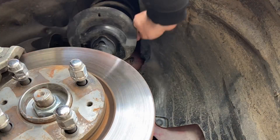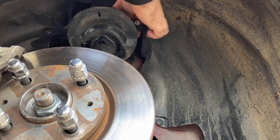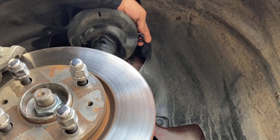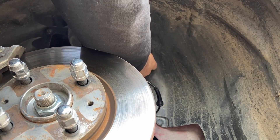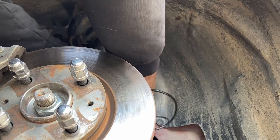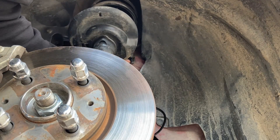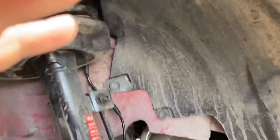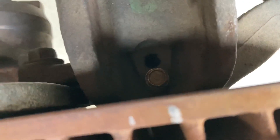Let's install it. All I'm going to do is pull out this connector, pull this off, and install the new one — it goes in perfectly fine. There's actually a spot right here to probably get a zip tie around, but we'll install this right down here. I am going to have to see if I can secure this somehow. And we have the sensor, which I just have to pull this little bolt back out — that's just a 10 mil.